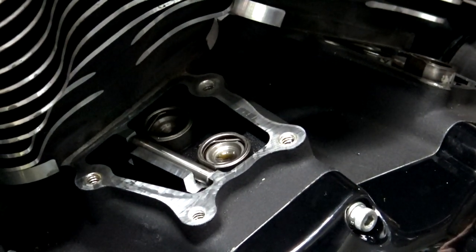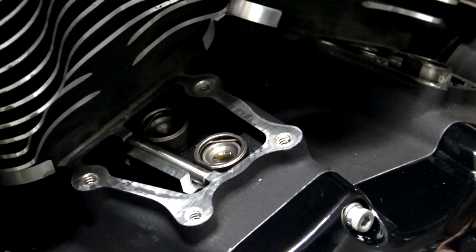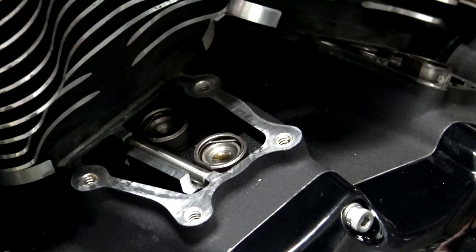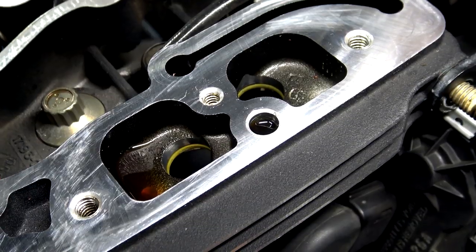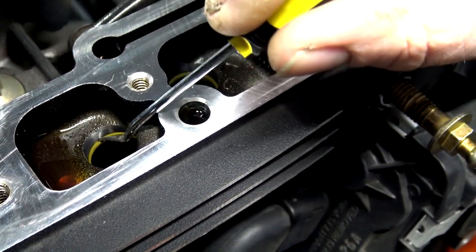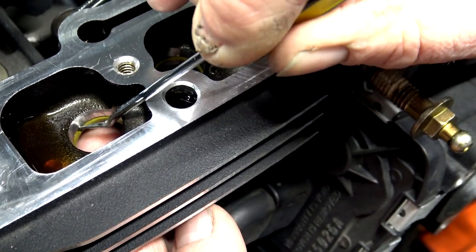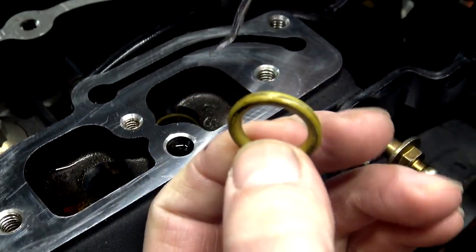You'll have to do that on both cylinders. Right now we're just going to work on the rear head and get that assembled, then we'll roll the tire and put the front cylinder on top dead center compression stroke. You want to make sure you don't have any pressure on the top of that cylinder when you're taking it apart and putting it back together. You're going to get all new O-rings — when you pull your push rod tubes out, you're going to see those yellow O-rings in there. Use a little pick to get those out; they won't fall out on their own. You want to replace those — they're one-time use. Once you pull this stuff apart, just put new ones in.